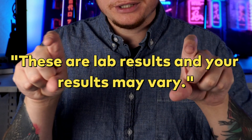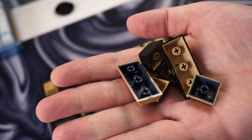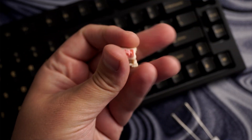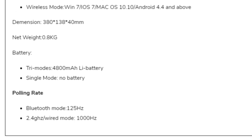Now that we've talked about what's included, the actual typing experience and sound is not as great as you might think, although I'm very particular and this is where preference comes into play. The keycaps included are double-shot PBT, but they seem to alter the sound of the board and make it sound kind of hollow. I also think that contributes to the fact that this is a case-mounted plate and not a gasket-mounted plate, which would sound much deeper and better. Here's a test between their keycaps with their keyboard and my own keycaps with their keyboard. The switches also sound a little loud and almost clicky in comparison — but if that kind of sound doesn't bother you, that's great. It also lists a 1,000 Hz polling rate, which is interesting as most Hall Effect keyboards advertise an 8,000 Hz polling rate. The overall sound of the board isn't great, though I'm sure there are mods to improve it.